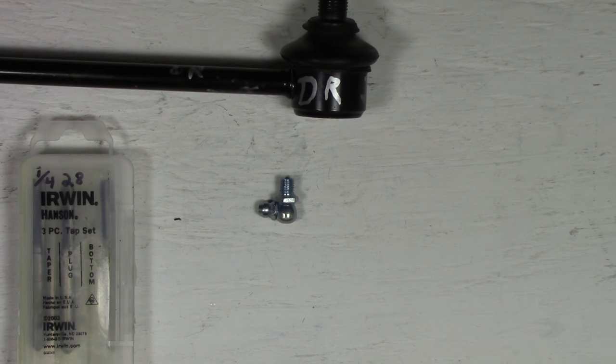And if you were to put that on the car right now and went over a bump, well, something would have to go. More than likely the top of the ball would be damaged or scratched, or the actual fitting itself would be squashed or damaged in some way. So what I'm gonna do here is just take that fitting off, back it up, and then put some washers and spacers in there. There it is. And now we got range of motion on that ball, no problem at all, as we should. But we want that with the actual fitting in there.